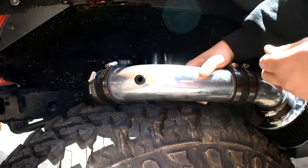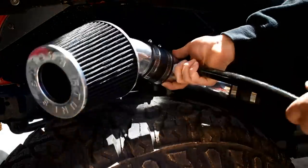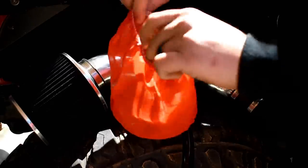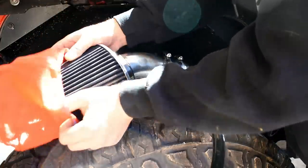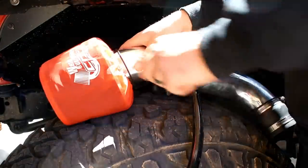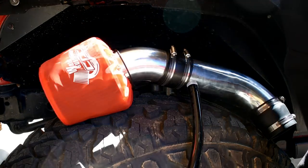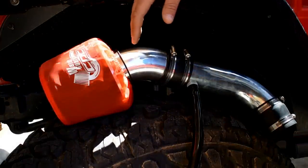You can get a black one, blue one, or red one. I just went with black because I don't like super showy stuff unless it's supposed to be showy. Hopefully this will work good and be a budget-friendly option. Now, one thing I would add - this is the water guard I was talking about with the open filter. It simply slides right over it. If you're going to go with a system that has an exposed filter like this, please get one of these pre-filters, one that's specifically made for water. I hate seeing people hydro-lock their engine when they suck in water through those open filters. At the minimum, get this or try to get a boxed system. Let's go check on the engine and see if it's hot.